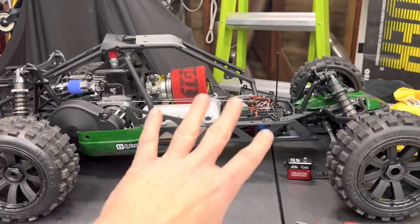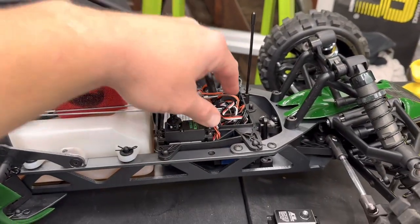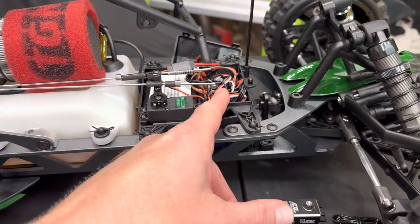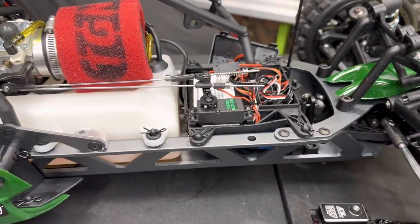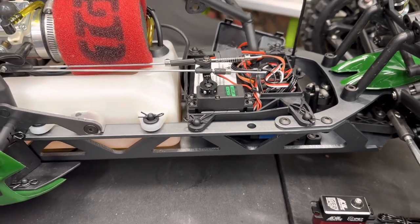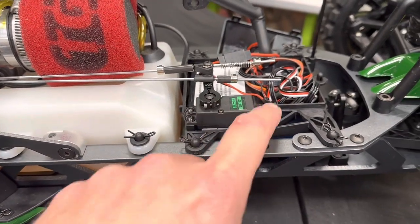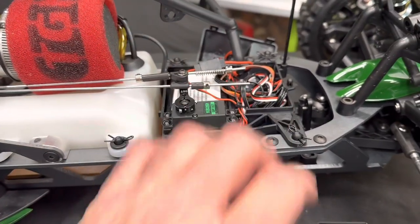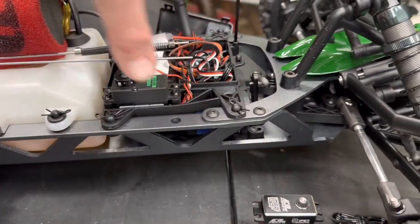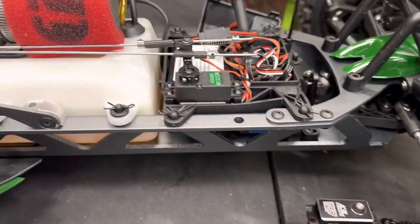So it's cool. You take that top body panel off, get the top cage off, get the cover off. I know there's a lot of wires because some of these wires are so long. I might take my time to zip tie them up. Probably won't, should, but doing the throttle brake servo, pretty easy. You can do it with leaving the whole assembly in there. Steering servo, you got to actually undo this, pop the whole assembly out and change it out. But this is pretty simple.